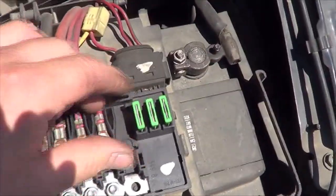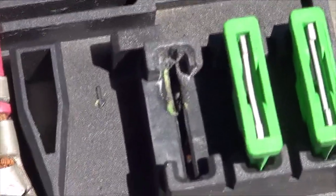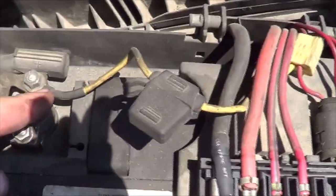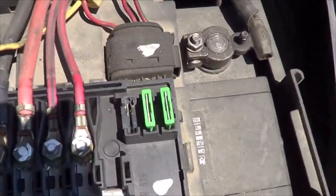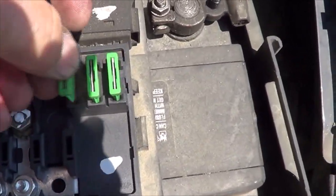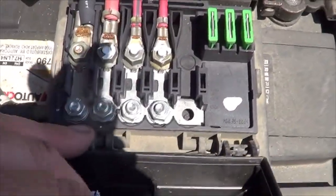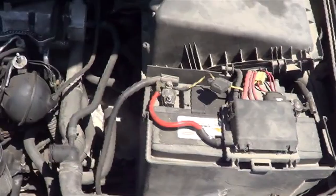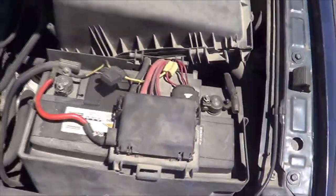I have another car here right now — I'll show you what a damaged fuse looks like. This fuse has some damage where it's been melted, and this car has been bypassed — they've built something here and pierced into that wire to bypass the fuse. I noticed that while diagnosing the AC. This one was just low on Freon and it's leaking from the expansion valve. You can see it's kind of green around the expansion valve. We're going to fill it up and fix the leak in a few weeks, but I thought I'd show you that burnt fuse.